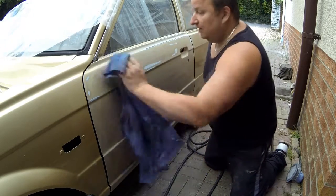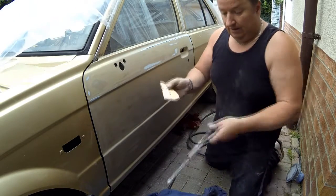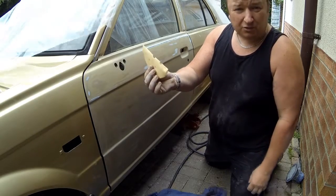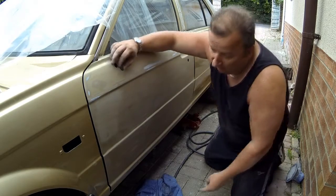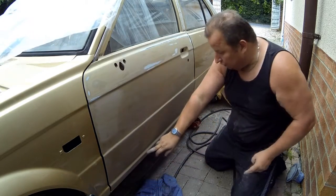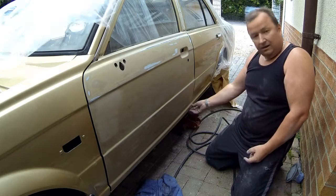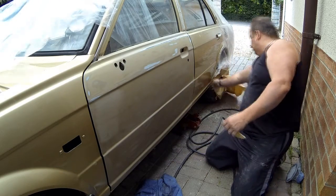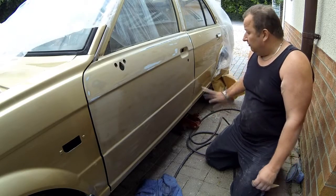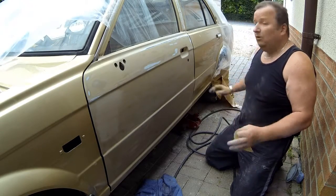And now, done. Wax and grease remover on it, and that's done. And this paper, if you've got an airline, cleans out very easily — and that makes all the difference. What I'm going to do is, where I took this chip guard up to this seam here, I'm going to continue it through the doors — just the lower edge of the door up to that seam there — just to give that bottom edge protection, because these do have stone chips on them and it's obviously a vulnerable place. So I'm just going to continue that line through to the rest of the car on the doors, and that will just aid protection for the bottom of the doors. I'm going to carry on and finish off sanding this door, do the same procedure to all the doors, and we'll come back after I've done that.